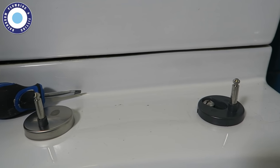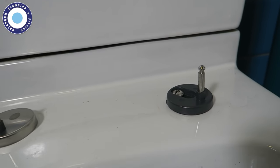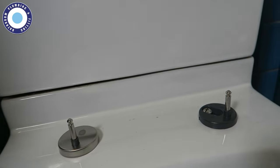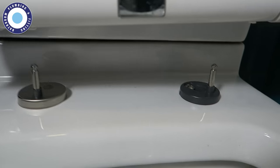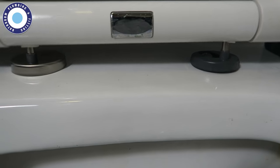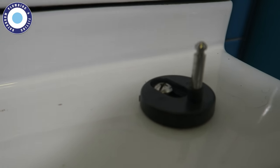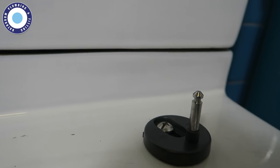So I think what's happened is somebody's installed this seat and just not fixed it correctly. The first thing I'll do is take my seat back and just align it so that I know these two spikes go straight into the grooves and we have the correct spacing. That's the correct spacing — I've not locked it into position yet, but what it will allow me to do is, when I tighten this, I'll just be able to tighten it straight into the correct position. The two spikes align precisely with the two holes on the underside of the seat.